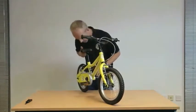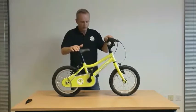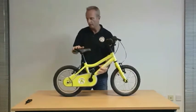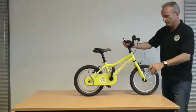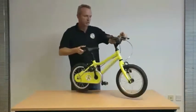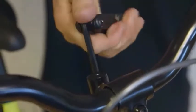The bike is now fully assembled, but before any child rides it it's important to go through a quick safety check to ensure all locking nuts are tight and the bike is ready for use. The first thing to do is make sure there's alignment on the front wheel with the handlebars — check from the top or from the back to make sure the front wheel is totally in line. Once you're happy with that, use the 6mm allen key to tighten the locking pin on the handlebars — it doesn't need to be over-tightened but clearly needs to be secure.